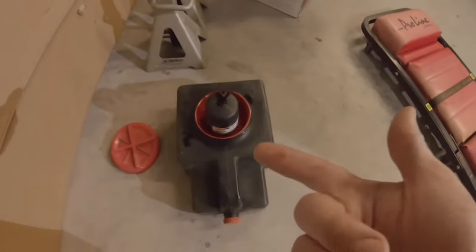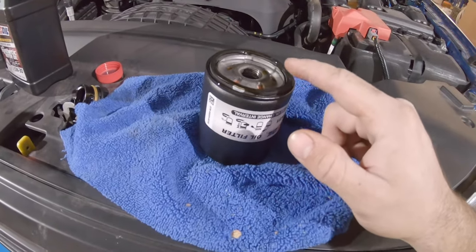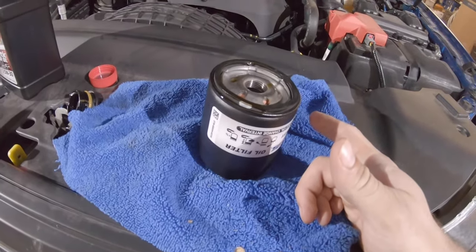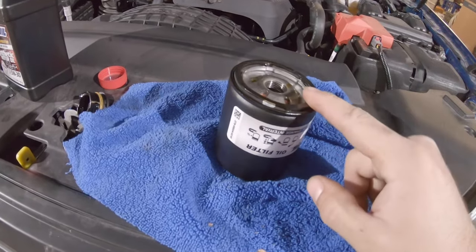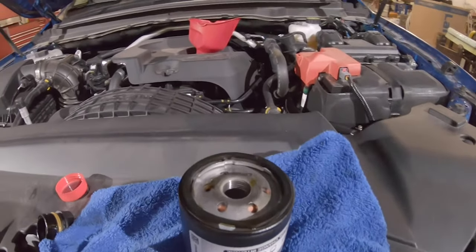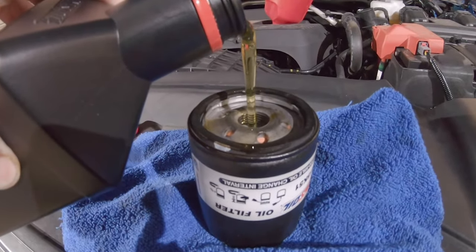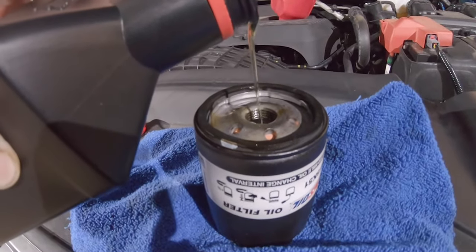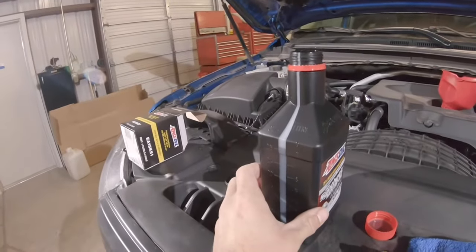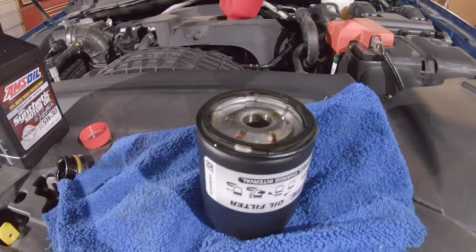Now we'll get the new oil filter on. I've got the old oil filter draining. You're always going to want to put a little bit of oil on these new O-rings, and also make sure the old O-ring actually comes off — you don't want to double O-ring it, as that puts too much pressure on the filter and it can fall off with oil spewing everywhere. Put some oil on this O-ring, and we're also going to pour just a little bit into the filter — maybe get it about a third to halfway full — so there's a little oil in it. Remember this takes 6.2 quarts total, so we'll do six more quarts and then use that seventh bottle to get that extra 0.2 to fill it up.